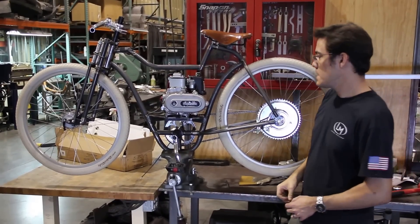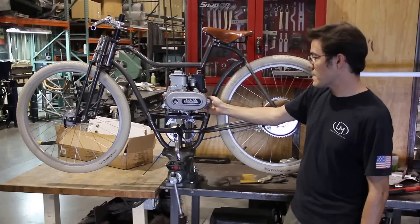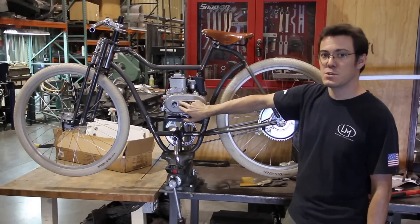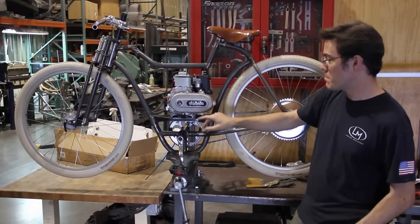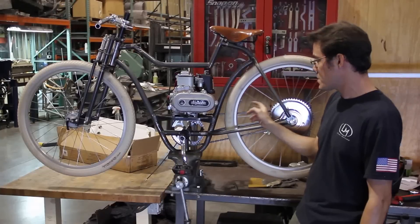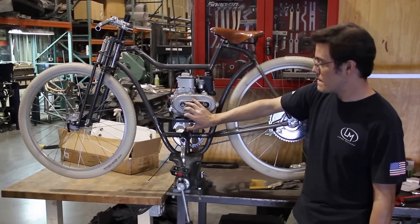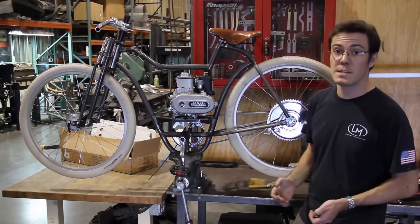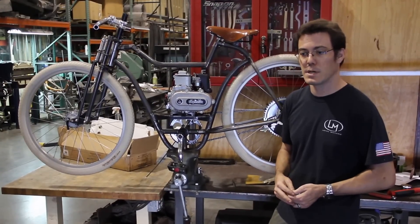The main reason for this is so that the force transmitted from the top side of the sprocket through the chain back to the sprocket on the transmission is in line with the crankshaft of the engine. When you have the transmission mounted vertically, the torque imparted upon the engine bolts equals the force the engine is pulling on the chain as it comes around the top of the sprocket, multiplied by the distance between the sprocket and the crankshaft. That torque on the engine mounting bolts is not ideal — it would probably work, but it may not be the best solution for long-term reliability.